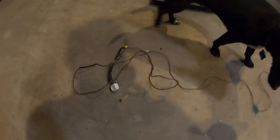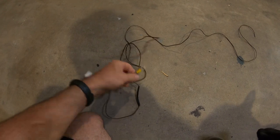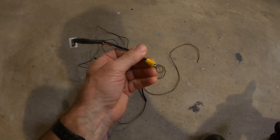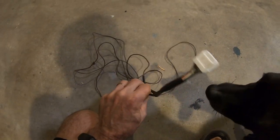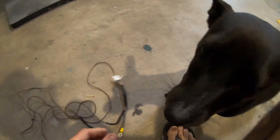Here's the latest wiring harness for the driver's seat. I just ran the brown wire and made it longer to run up to the fuse box so it will always be on. I ran all the grounds to one lug. This should be for my power seats, so my driver's seat will work all the time.